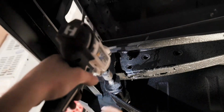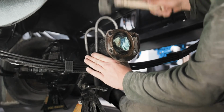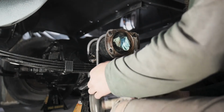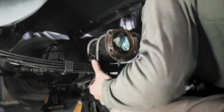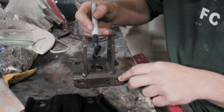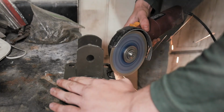For this car, I wanted to get traction bars, so in case I wanted to step on it, I would be able to without a bunch of wheel hop. To install this, bracket bolts onto the underside of the spring brackets. Unfortunately, I did this incorrectly because it comes with a notch pre-installed on it, but I installed these spring brackets on the wrong side, meaning that I had to cut notches in the wrong places.